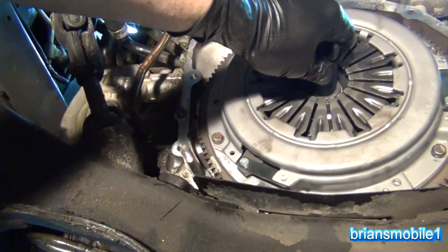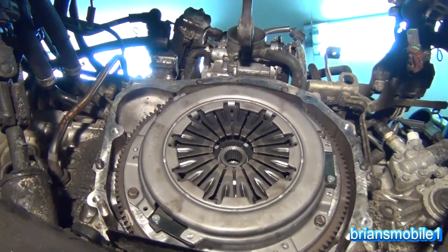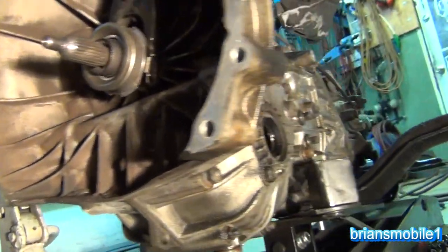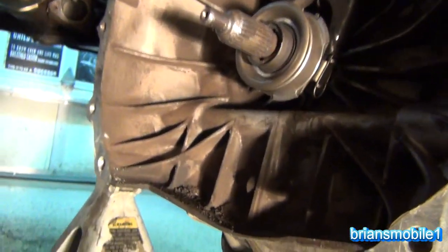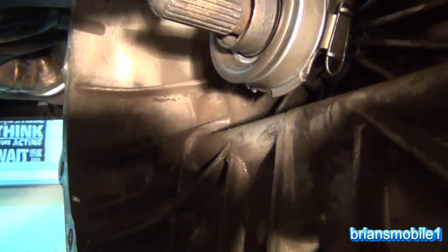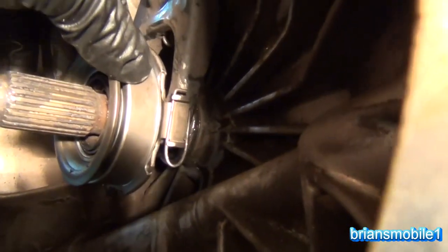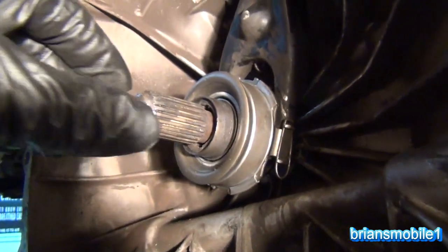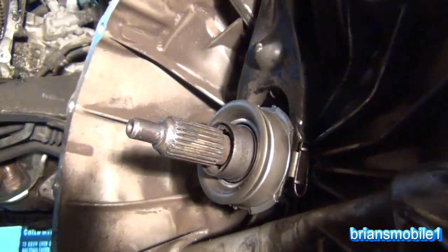If it's kind of suction fit or burps when you pull it out, that's okay, but it shouldn't drag at all — it should be real smooth. When you're going to put the transmission on you want everything smooth and as easy as possible — you don't want to fight while holding this big heavy sucker up, full of heavy steel gears and shafts. So we've got our throwout bearing on. The new sleeve is driven on — there's a little lip on the back side. Take a screwdriver and a hammer and tap this side and the other side gently, making sure it's moving so that you don't mar it, because you want it to be able to go all the way back as it needs to.